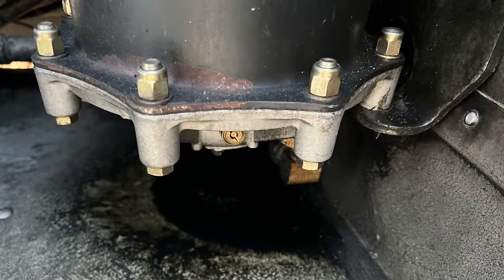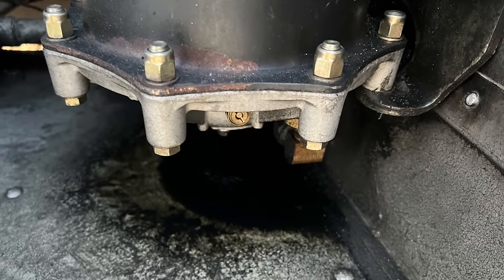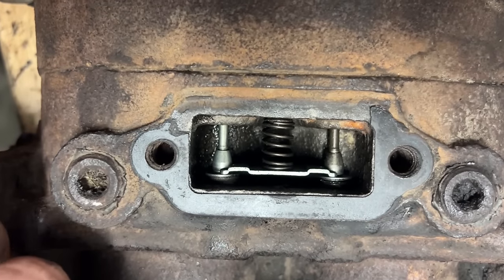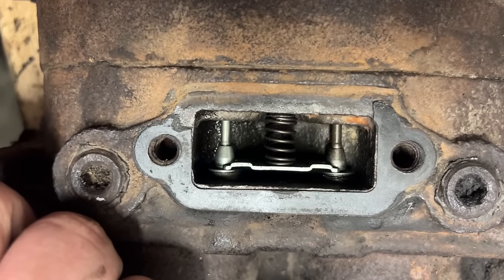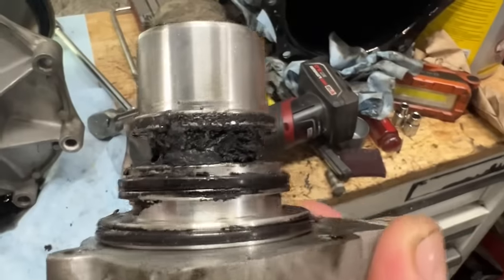Well, the air dryer is not purging, but when it was purging, it was passing a lot of oil out of it. Since the air compressor was passing so much oil, we're gonna replace it with a used one that we have here. I just wanted to show how the unloader valve works. So when it builds up an amount of pressure, the governor pushes air through here, that stops the compressor from making air.